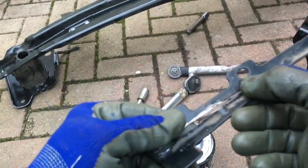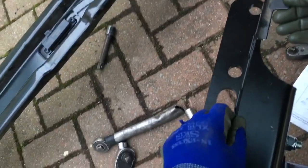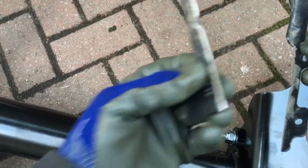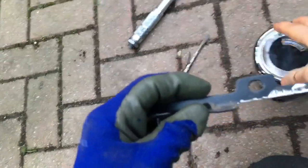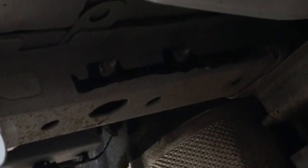The left-hand side cut removes the section that would interfere with the tow bar. Similarly on the right-hand side, the same cut is made so they don't foul. Because the metal has been cut, give them a coat of rust-proofing paint — I'm using Hammerite metal paint, which can be applied direct to metal.